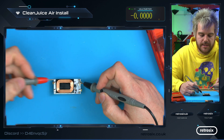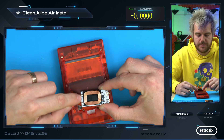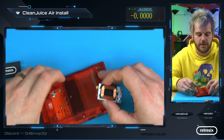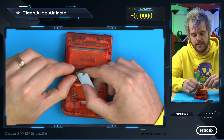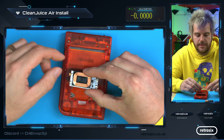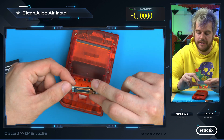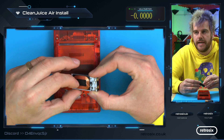When power passes to the output pins, it should output the correct voltage. If you have voltage coming out of those pins but the console doesn't boot — yet it does boot with batteries — then the battery springs may not be making contact with the inner spring. In that case, bend the top pad outward slightly. The bottom one will always make contact because it's pushing against a spring, so the one to check is the top spring in the battery compartment. These are all tested one by one by hand, so you shouldn't have any issues, but that's how you diagnose.